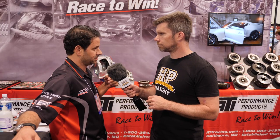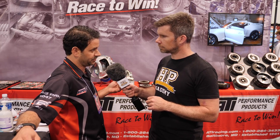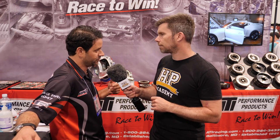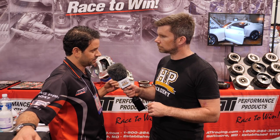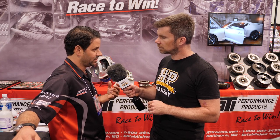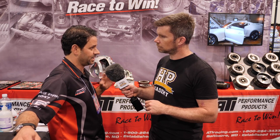Your engine balance — let's say 50%; some guys that run NASCAR balance to 51, 52, 53% so the engine has a little bit of inertia to keep going — and that also affects the damper, but not greatly. It really comes down to crankshaft stiffness, how stiff the block is, how much your bob weight is, what RPM you're turning, and ultimately the torsional twist is going to be in any crank.